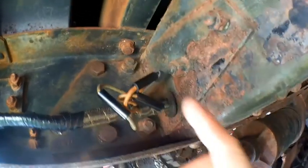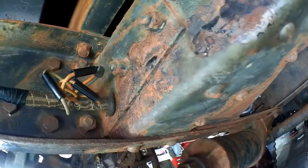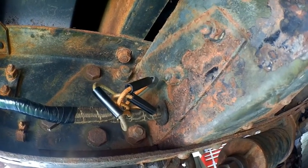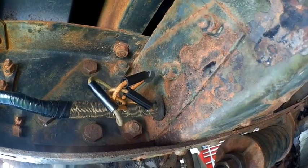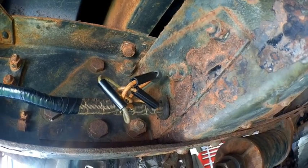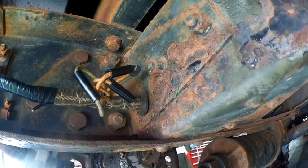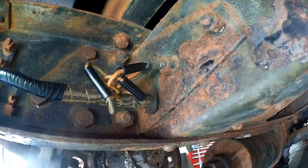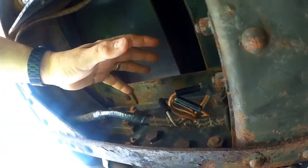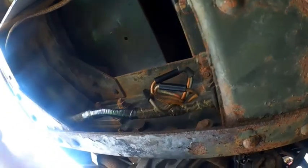And I checked the continuity of all these wires. So like number 15 is, let's see, that would be for the brake switch, the electric brake. 14, both, I think both those, or maybe 12 and 13 for the electric brake, and then the 14 and 15 were for the light switch itself, for the brake light. So you've got two sets of wires up front by the brake system for that. And then depending on what kind of track, and this is kind of a universal, you would tie those into here if you were going to use your trailer.